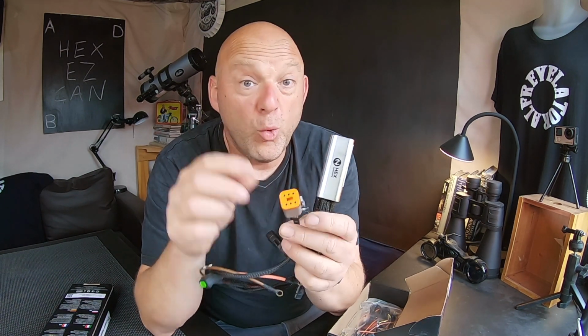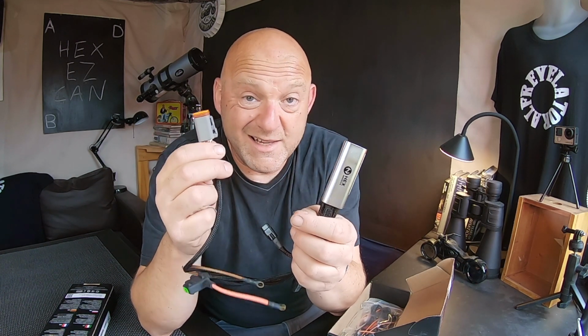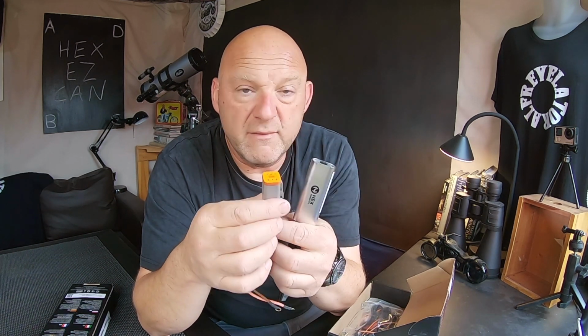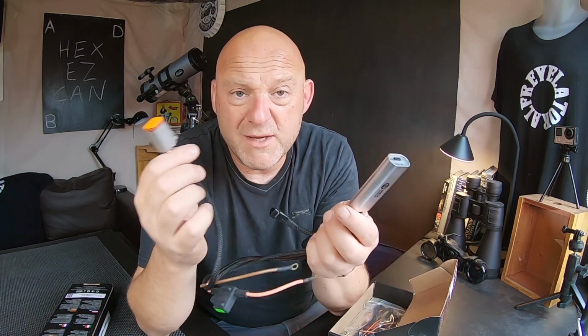So one immediate drawback that I can see with this, well, not with this, it's a great system, is let's say if you have a tuner connected to your motorcycle by this data link connector, obviously to get this powered up or to use this, you're going to have to disconnect the tuner, so it might not work in that regard. But let's say you put an FP3 tuner on your motorcycle and you're only putting the map on there, or you might have gone through its auto tune process for 2 or 3 weeks, then you can take that off. You don't need to leave it on there. So you can ride with the tuner, or you can take it off. Once you've taken it off, you just connect this in, and then you've got all your accessories that you want.